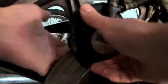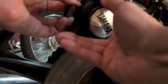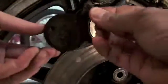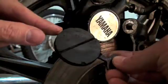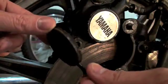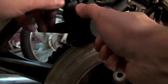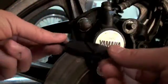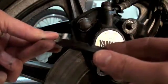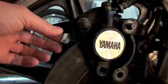Now let's remove the caliper. I'm going to try to catch my pads because I don't want them to fall out on the ground. My pads have come out. Here's the first one — you can see this is the friction material that goes against the disc itself, and there's not a lot left on this one. This one is pretty close to needing to be replaced. The other one is a little thicker. That's usually a common sign when you have your brakes dragging, because it means the thinner one was the one that was dragging. I'll replace them both.